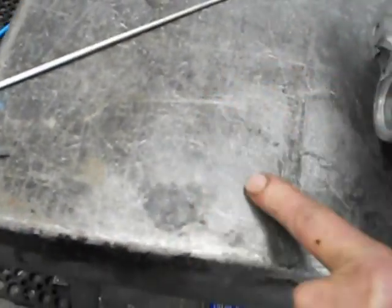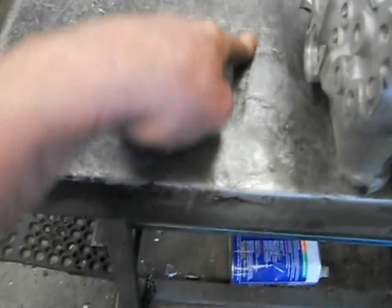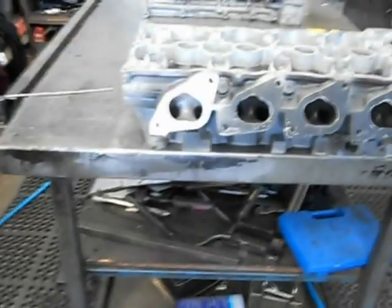What I've done is concentrated on the inside radius — just down there. In actual fact you've got your short side radius coming around at an angle like that. If I take some off the top, that then makes that radius a lot more flat and you're going to get much more high flow.